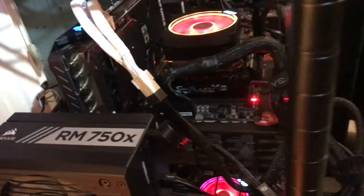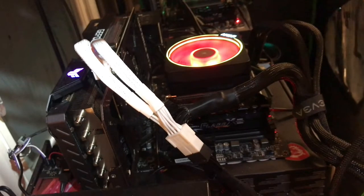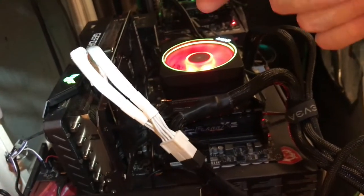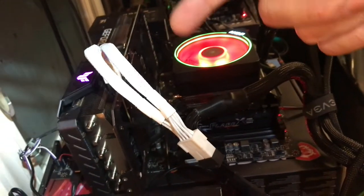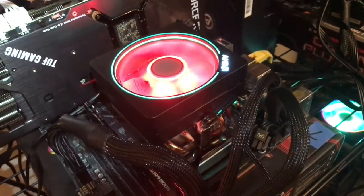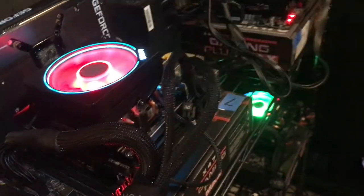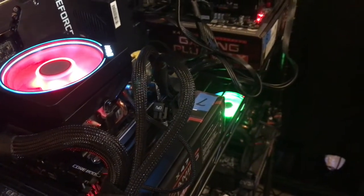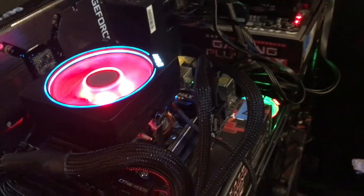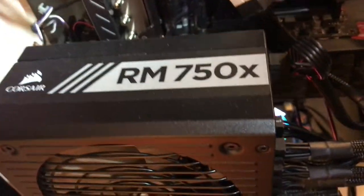And then you learn that a GPU draws a certain amount of watts depending on what you're mining. And I think this card, I'm just going to guess, is 150 watts, the 3070 Ti. And then you take how many watts this CPU, this Ryzen 9 3900, and the motherboard draw. Let's just conservatively say I'm under 400 draw, which I'm sure it's a lot less. But I know a 750 is definitely going to be able to handle that.